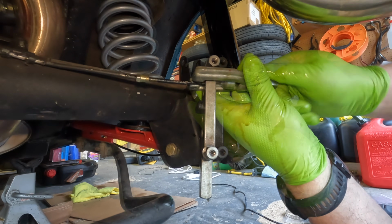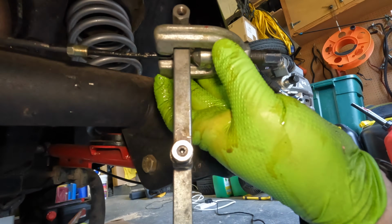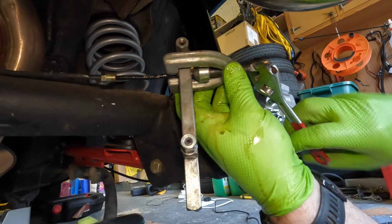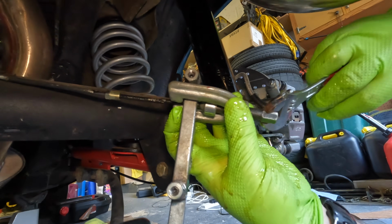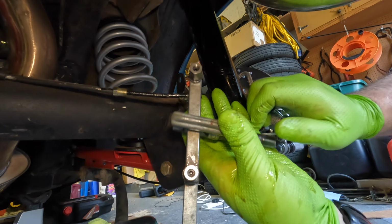This is the classic thing that people do, is they smash the heck out of these things on the double flare, and you just kind of have to give it a little bit of a tap, one tap, turn, and that's it. Because you want the ultimate compression to be done as you're tightening it to the fitting it's going to go to.